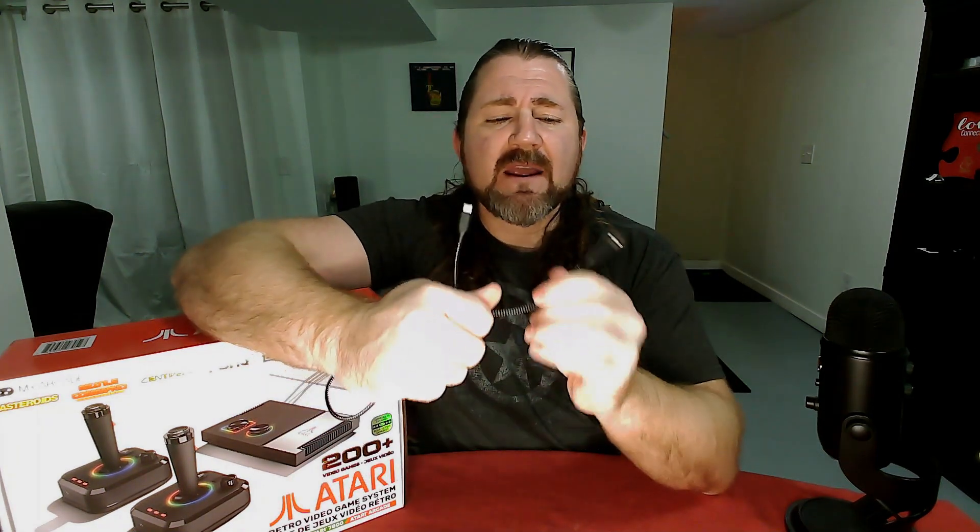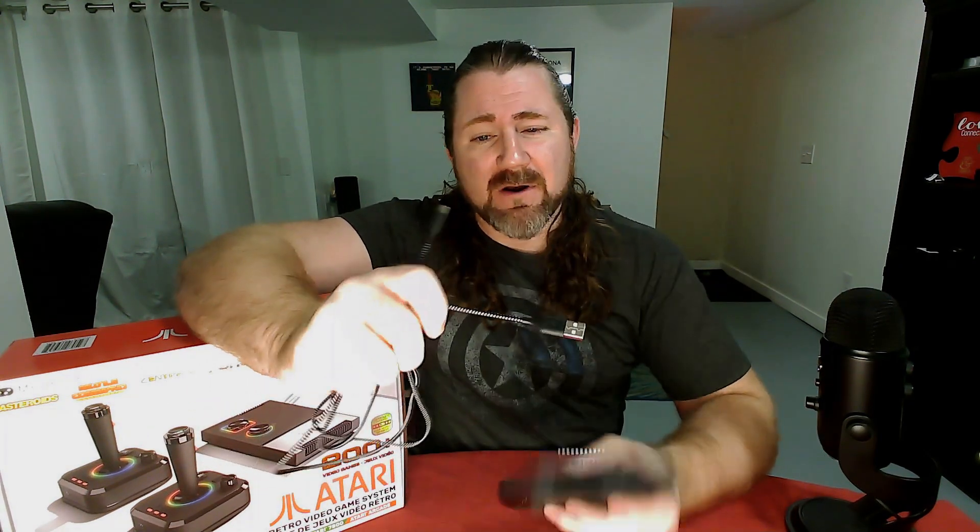So what do you need to update your GameStation Pro? First off, you're going to need a computer — that is a must. You're going to need a little wire so you can hit that reset button on the back. And lastly, you will need a USB-C cord to hook up your GameStation Pro to your computer. The power cord that came with it won't cut it, because that only does power. You need one that does power as well as data transfer, like a phone connection.